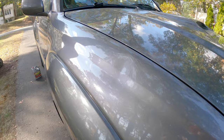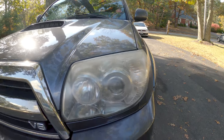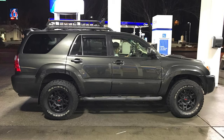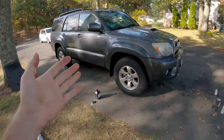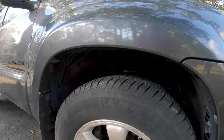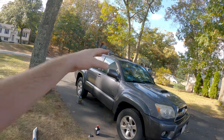We still have a few more things planned for the 4Runner. There are a couple dents and scratches to address, as well as these oxidizing headlamps. The salty climate and harsh winters of New England can seriously do a number on your car. These alloy wheels are starting to oxidize too. I've been researching tire and wheel setups — if you go with a larger diameter tire with a thicker sidewall you're going to have some rubbing issues. That brings us to ride height — very common upgrade for fourth gens. They're heavily raked from the factory, about an inch and a half to two inches less wheel gap in front than in the rear. The suspension needs a refresh, so we've been looking at Bilstein lift kits, which would address ride height and ride quality.